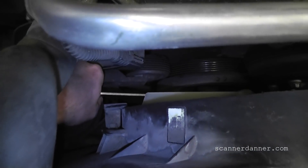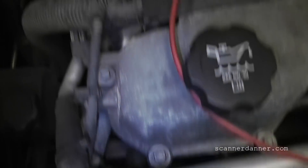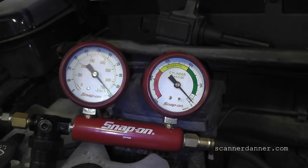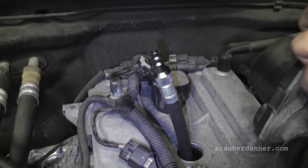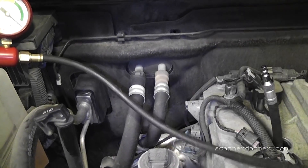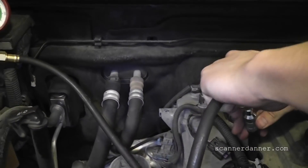I have some students helping me here. I'm the one holding the crank in case the wrench goes crazy — so I'm the one that gets hurt, not them. We zeroed the gauge as best we could; it keeps moving on us. Our airline is connected, we're at TDC. Go ahead and connect it, but use two hands, Nick, because I might need you to unplug it right away if the wrench wants to take off.